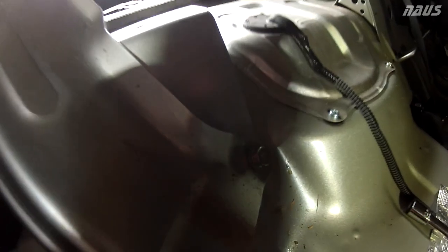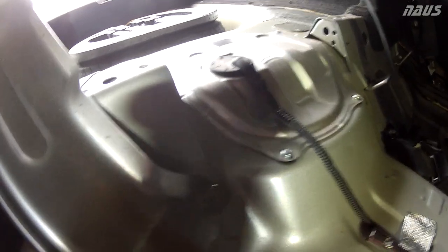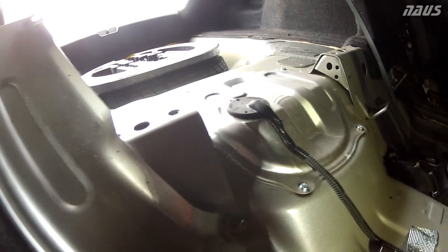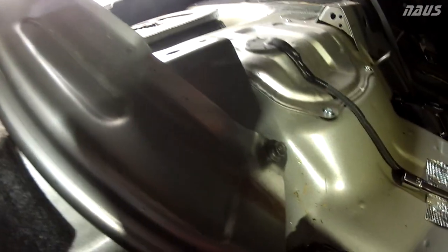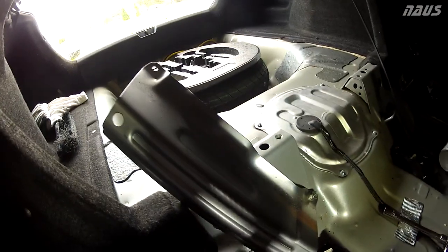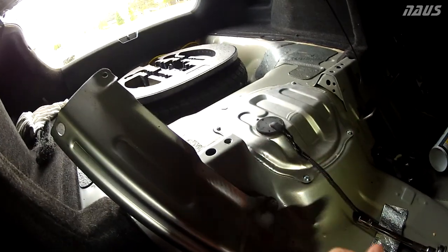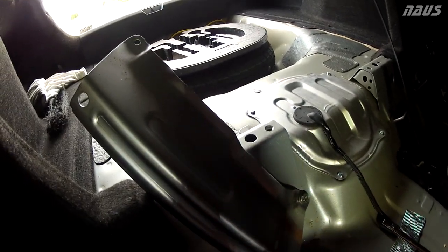If your car has got 140,000 miles on it and it's had some salty winters, you're most likely going to have some of these bolts kind of rusty. I tried working this one with PB Blaster and I just snapped the nut off on the inside of the frame. Luckily I only had to deal with one of those, so I can swing this out of the way now, but it is loose in there.